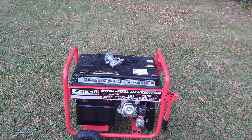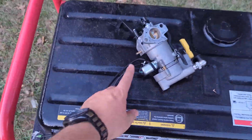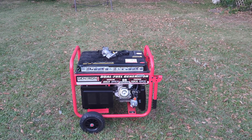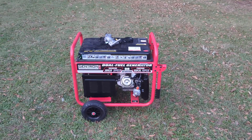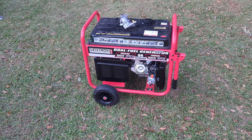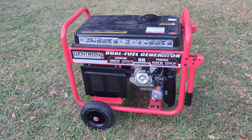Getting a little extra fuel out of the carb is a much smaller problem than being without power. Just pull the solenoid wires and it should work fine. I really hope this video helps somebody — we all use generators during emergencies, and that's not the time to be fiddling around. Thank you guys for watching. If this helped, please give a thumbs up, subscribe. I'm going to put the phone down and turn it on so you can see it running. Check it out — it's running on gas!